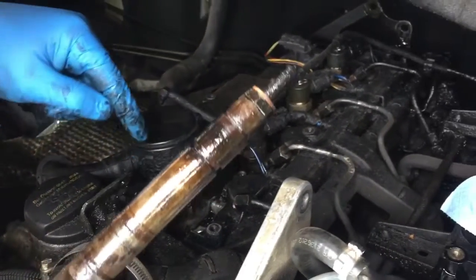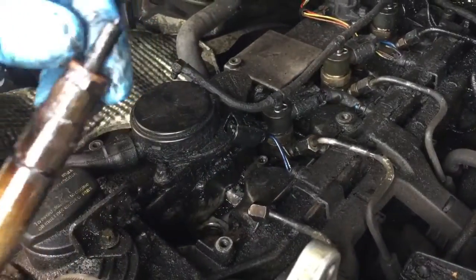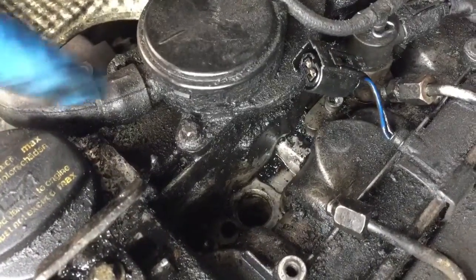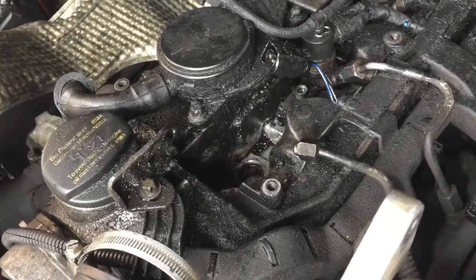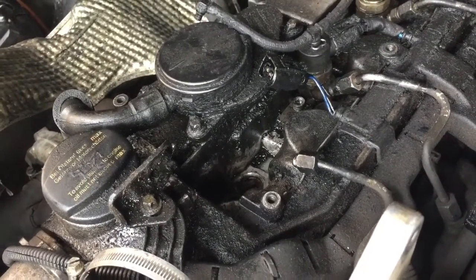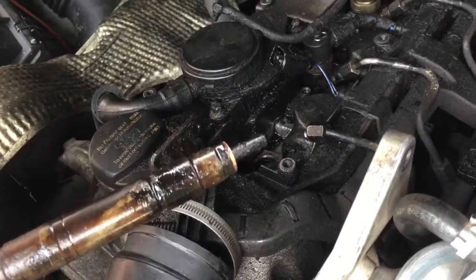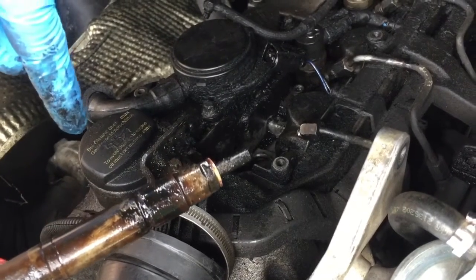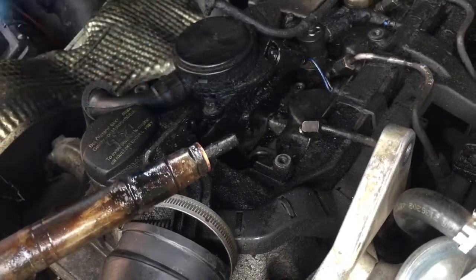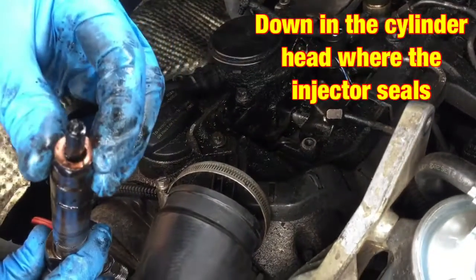I'm going to check down there to see what the seat is like. I think the seat will probably be okay. I have got a reamer if it needs to be re-reamed. You won't be able to see down there, I don't think, if it did need to be done, but I don't think it will, because I did that last time, and I haven't been running it for very long with it popping. When you continue to use it, when the gases are coming out, it can make a little channel in the aluminium, and you have to ream it just to get that out, but I think this will be fine.